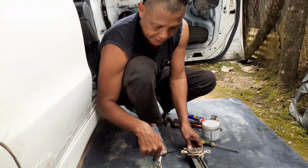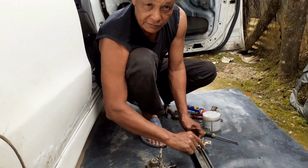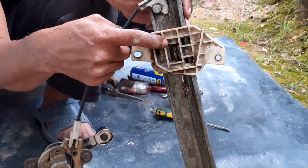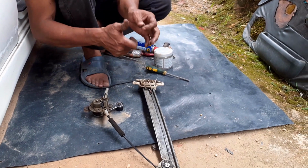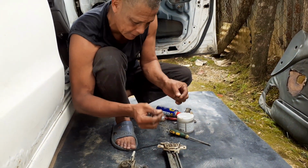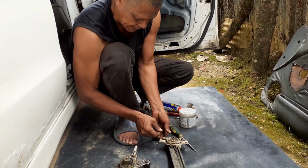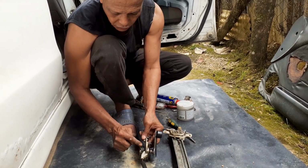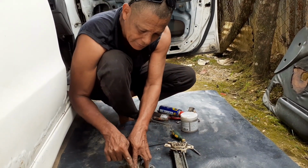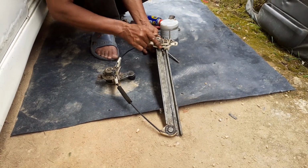Make sure when you're going to change the cable, if it's broken, this is fully at one end. And the end it should be is opposite from where it's going to slide. Now, if you look inside here, see inside here? Looks good. Now, you can use a crimp to crimp onto the cable. That prevents the cable from sliding back further forward. Now how you do this, you get the bicycle cable and you give it about this length over and you crimp it, push it in. You're going to remove this and slide this through here and you're going to push around the cable and run it back in the exact groove as how this is. When that is done, you slide it back through here. Ensure the tightness and there's no play. It must be firm and this must be 100% up.